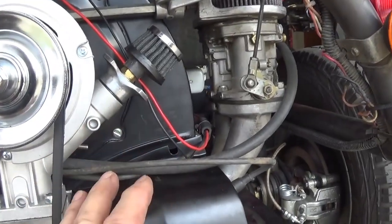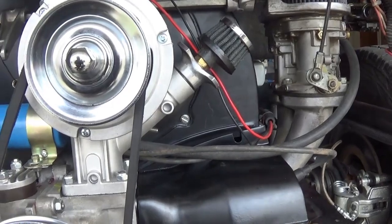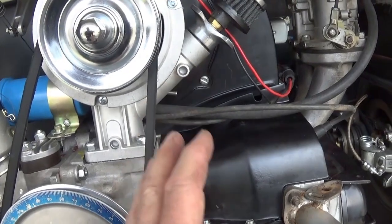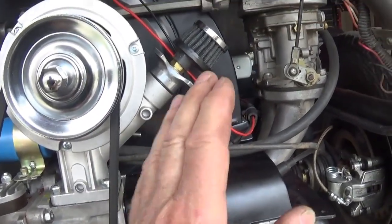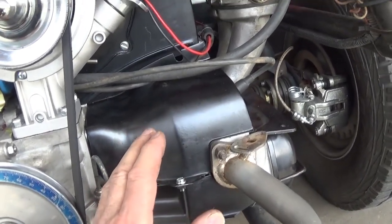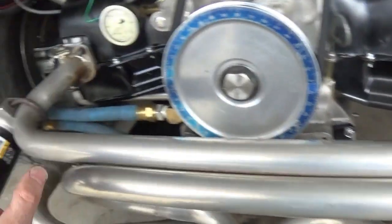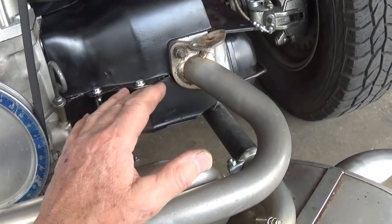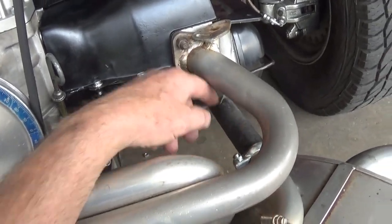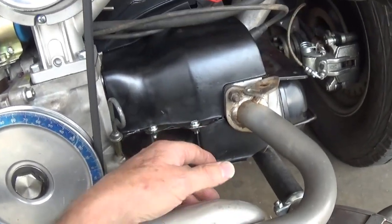Now these carburetors work fine up to 5,000 RPM on this one. I had them on my 1800. But this is larger displacement. You're moving more CFM, more air. Maybe I've got to figure out where the restriction is. If I step down, I've got a somewhat free flowing valve exhaust for a stock valve head. These are 1 3/8 J tubes, and these aren't the 1.5. These are the smaller ones. I think these are 1 3/8 as well.